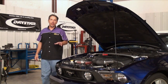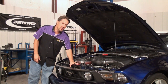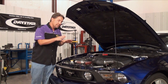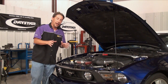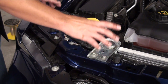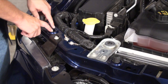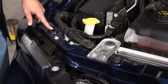The first step in the process is figuring out exactly where you're going to mount the hood pins. Generally speaking, the core support is the best choice, but regardless, you want something solid that's not going to move. Depending on the particular configuration of your car or truck, you may need to build some brackets off of the core support in order to properly locate them with the hood. But as you can see here, we have a couple of hood snubber locations that are going to serve as the perfect potential mounts for our hood pins. These simply unscrew, like so, and the hole is even pretty close to the right size. We're going to use this outboard mount rather than the inboard location because this one interferes with the white stripe on the hood.